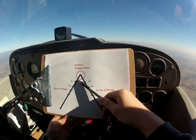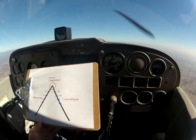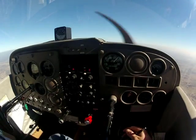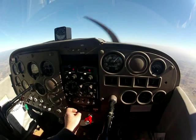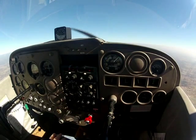So we want to focus on rich of peak. I'm going to show you first how to lean off of the tachometer. I'm going to turn the squelch up so maybe you guys can hear the motor. I got my power set about 2,300 RPM — that's where I got cruising altitude.